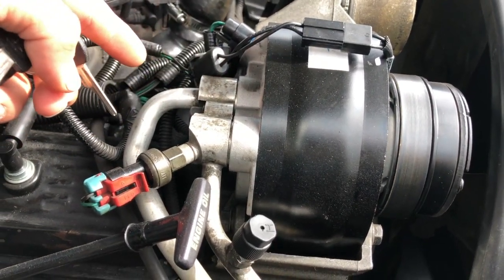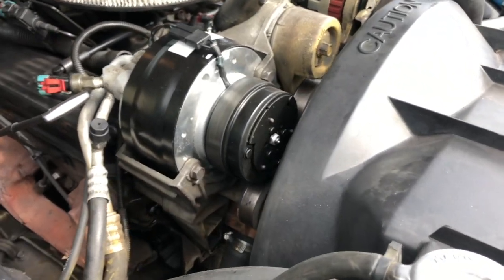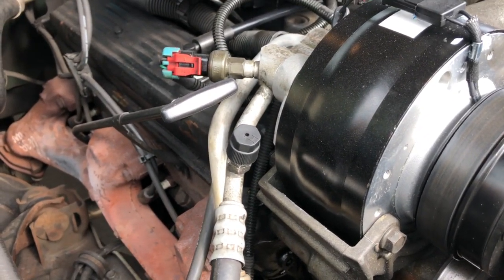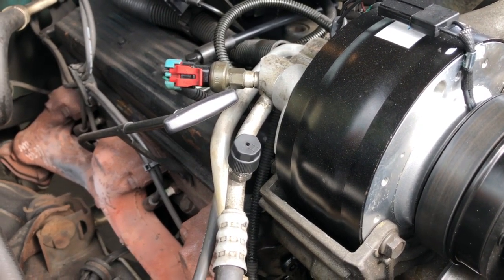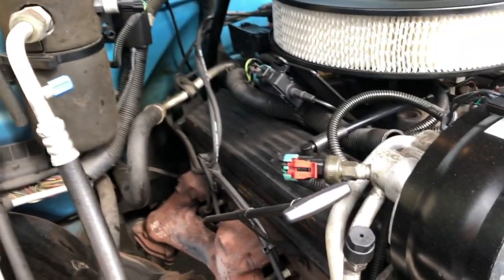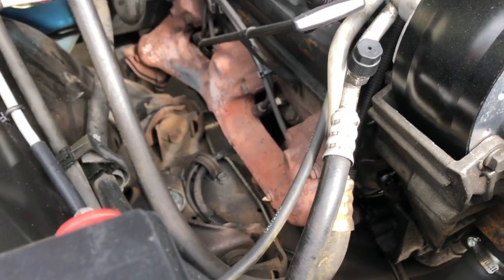Of course, you gotta take your connectors off. It'll pop right off. When you put your new one on, make sure that you pull a vacuum on everything. Make sure it's not leaking, and then pull a vacuum for like an hour, and make sure you get all that moisture that probably got in there while you were changing everything. Make sure you got all that out.